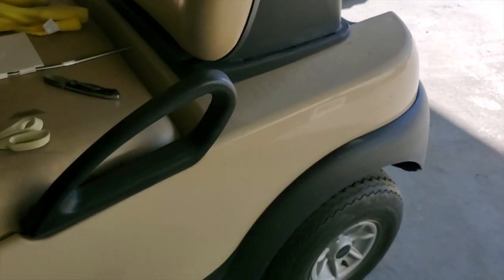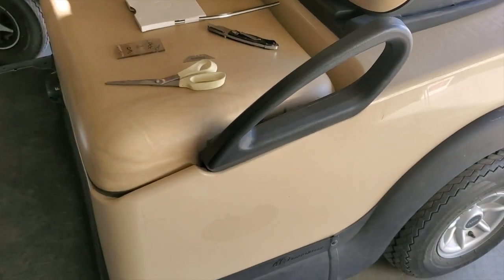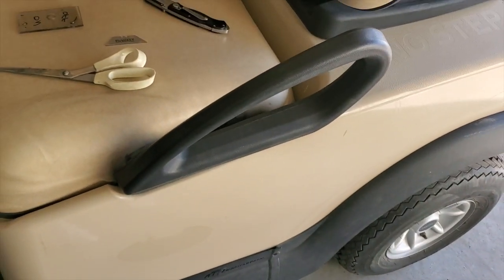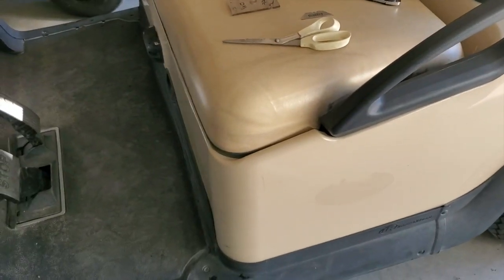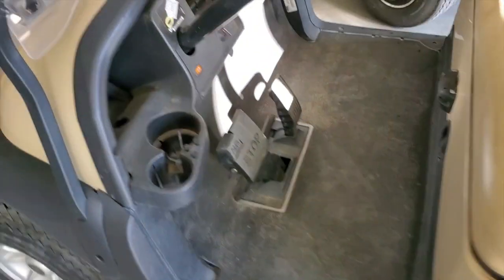First thing you need to do is wash the body, your area. Clean it real good, and then once it's dry take some alcohol or one of those eyeglass cleaners and just rub where you're going to install the tape. Once you do that, lay it out. I took a tape measure and a pencil and made some marks that wipe off real easy. This is where I'm going to end one end of it, and I'm going to end another one right here on the back. I did the same thing on the other side for marks, then marked the front similarly where I wanted the height to stop and start.